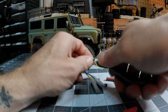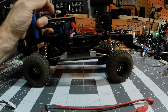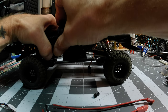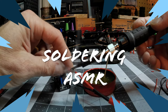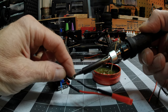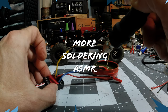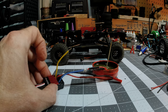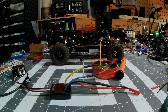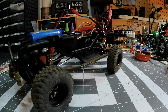It's putting a battery connector out here. I feel I'm never going to use this connector again. Let's see how much I need — battery connector. VST all the way up. There we go. Switch is still a 10. If your motor leads are opposite of what they're supposed to be, that's essentially what you have to do anyway. So that's kind of the advantage of those connectors — being able to change that at the connector. And power switch. It is already paired. There is the servo.